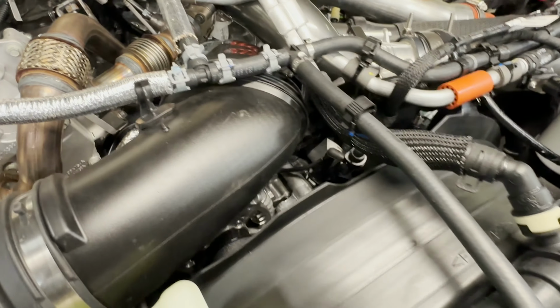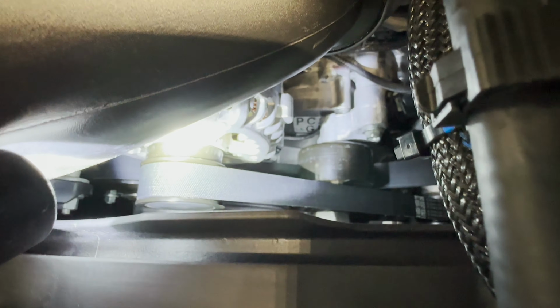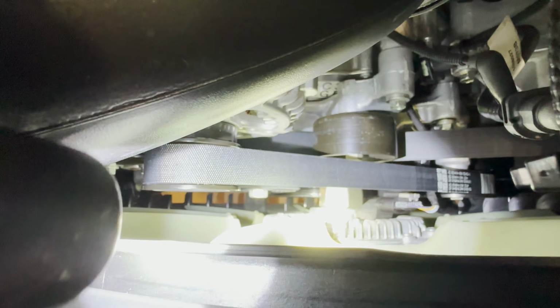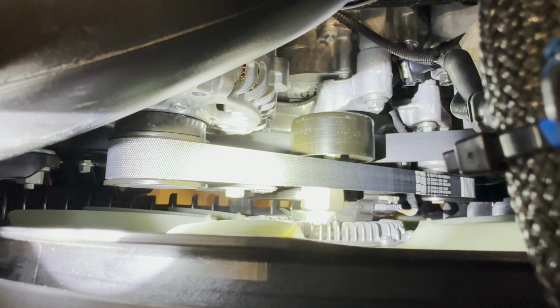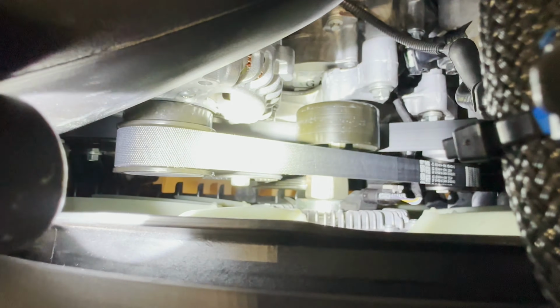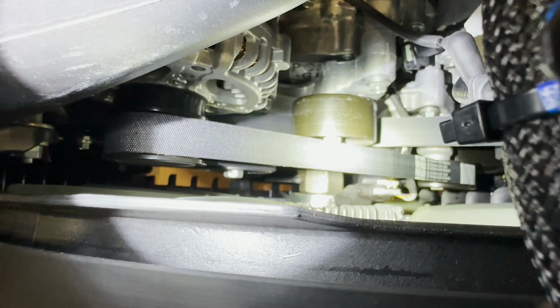Okay, so the next thing that was different, let me turn the light on, see if you guys can see down here with me. This is the high output with the Pro Power generator on it. And because of that, we have two drive belts. What we do when we take off, you can see where I tightened it, and you can see where I loosened it right there in the fan clutch. You want to take the fan off, and I just lay it down here in the fan shroud, and that's typical for doing the S&S. There's no real reason to take it completely out of the vehicle. But what that allowed me to do was get to this tensioner right here. You can see the light, you can see right there. I'm on it now and now I'm off of it. So that tensioner has got to come up and release the belt, and you can take it off and immediately pull it up out of the way.